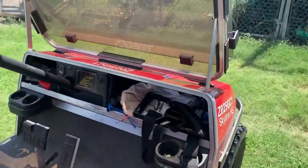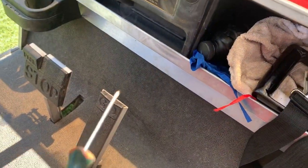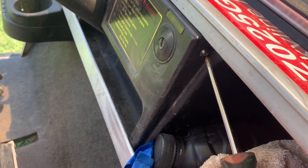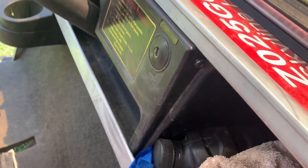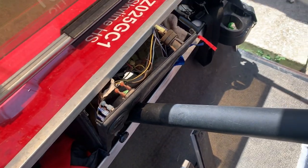Here's a little trick a lot of people don't know about on Club Cars: if you're trying to order parts and your parts department needs a serial number, but the one stamped down on the bottom rail is missing, they also have a serial number right behind the dashboard. Take this screw out and the one on the other side — you don't even have to take them all the way out, just loosen them up. Then the dashboard will pull out just enough to get that serial number. There it is. Take a picture of it and save it to your phone — you'll always have the serial number you need.